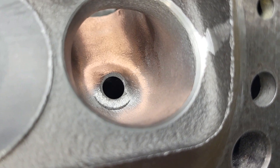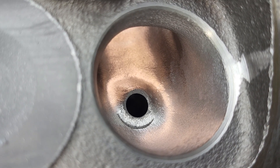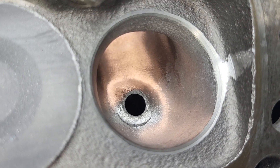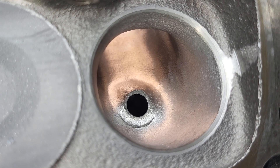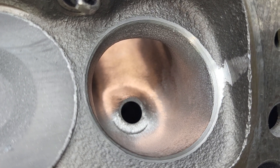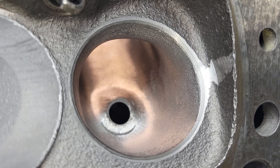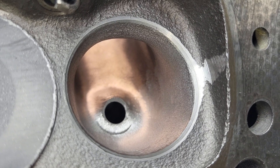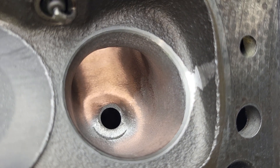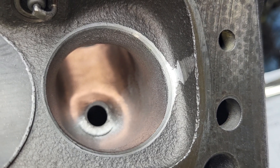Seems like I take a lot out and then I check the ratio and it barely changes. We went from 87.8%, which was a winner, to 88.7% — not even one full point — and it was a big loser. Gives you an idea how temperamental this can be. When you open up the throat, you are going to change the short side a little bit. In reality, the bottom of this bowl could be brought out a lot more and it would probably help, but that's changing too many variables at once.